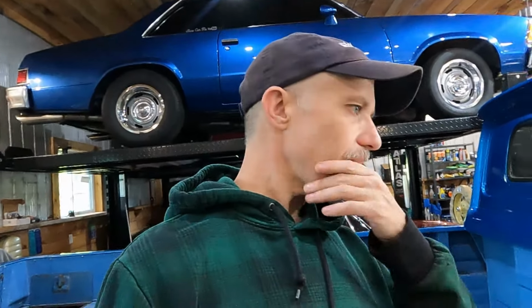I know sometimes I've had it before where the torque converter will drain down overnight, especially if the car is sitting for a long time. If the car is sitting for the winter, it almost always happens for Powerglides in my experience, that the torque converter will drain down and fill the transmission. And when it fills the transmission, then the weakest point leaks, and usually that's the O-ring around the shift cable or something like that. Not the case on this one, though. It's coming from the bell housing. I don't know. Anyways, I got a trunk weather strip that I'm going to do on it. Other than that, I'm going to be driving this car, see how it goes.